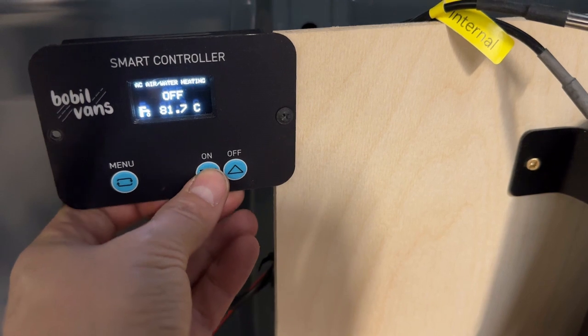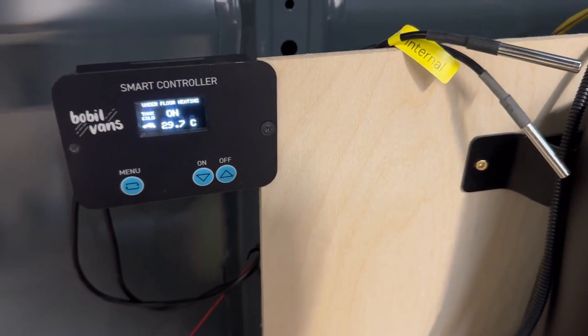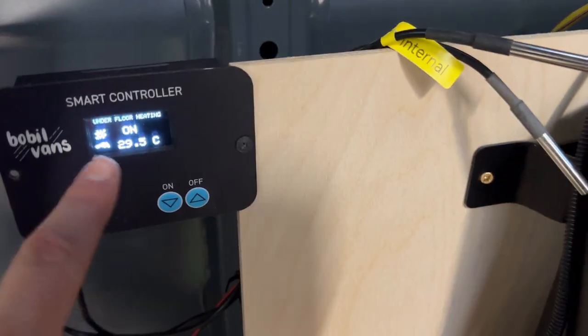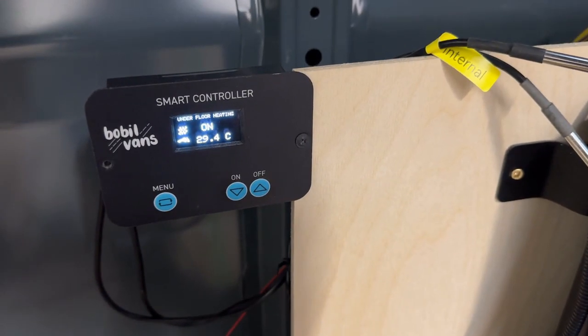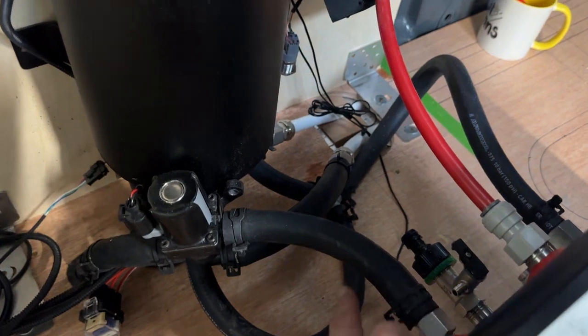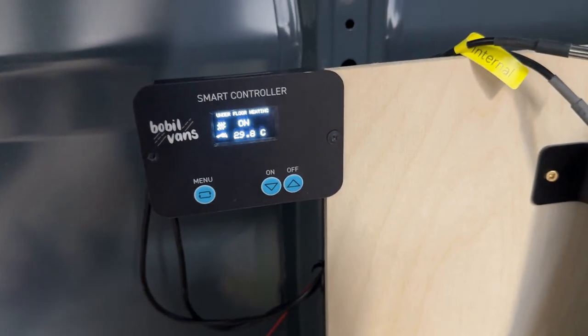One feature that is really nice is our AC air and water heating routine, which keeps the van warm when you're on hookup by using the element in the calorifier — and that does work with the underfloor heating. You can hear it just turned on, starting to circulate the coolant, and the blower box is on because the temperature in the van is a bit low. As soon as we've got some hot coolant pumped around, the valve turns on and we send that coolant underneath the floor. If it detects that the coolant temperature drops, it'll divert the valve back through the tank to reheat the coolant and keep doing that until the floor is warmed up — a really nice feature for when you're on hookup, using someone else's electricity rather than burning your own diesel. So I hope that's been useful. If you're looking at going to colder climates, living in your van year-round or for ski seasons, having a heated floor to step onto when you wake up would be a fantastic addition. Any questions — info@bubblevans.co.uk, give us a ring, or drop them in the comments below. Enjoy your van build!